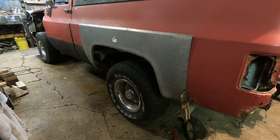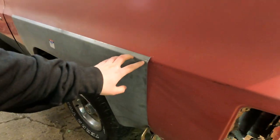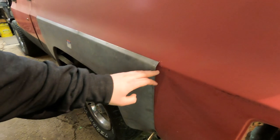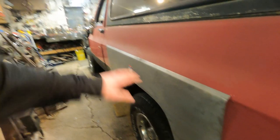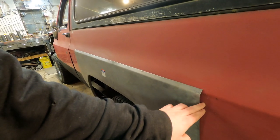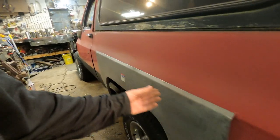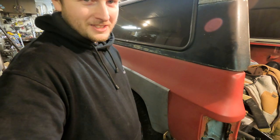So I just got that cut out and I just clamped this back in. You can see that this is where the bends they put in here don't match up to the body line, so that's why you kind of can't go off of that. What I'm going to do is mark a half inch down on my body, transfer the lines onto this panel on both sides, then mark a straight edge across this and cut this panel. And then on the body I will mark it an extra half inch down so I can go with my flanging tool and make a flange for this to sit into. It might not be the preferred way to do body work, but for somebody at home it just helps keep it a little straighter.